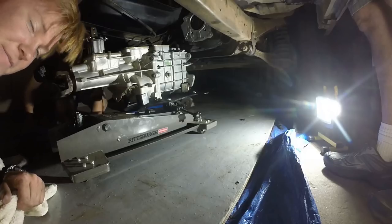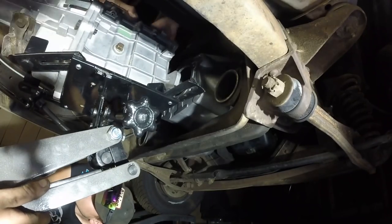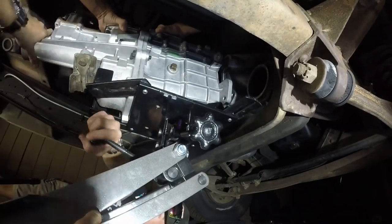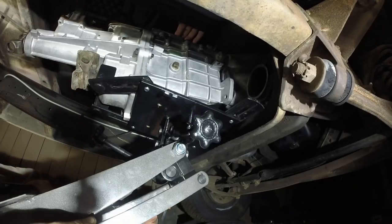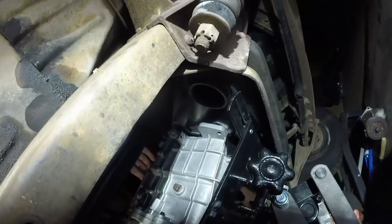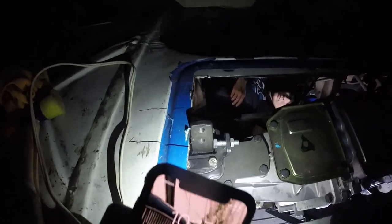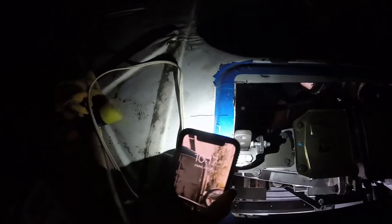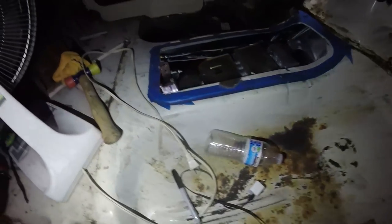We are in alignment — touching. But we can't raise it enough. The bolt wasn't there, Greg, it would go in. So I've got to cut right behind this bump. I definitely do — 100%. It's catching right about here, there's about an inch. There's like one inch from this little seam where it's hitting. So I've got like two and a half, three inches that I'm going to cut out as a box, and that'll allow us to clear the little shifter section. But everything looks like it lines up pretty well, so I'm going to take it out, trim it, and put it back in.